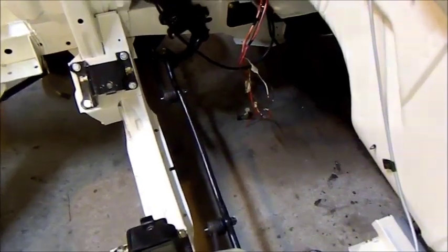And I finally got the right inner tie rod ends, and you can see, looking at this, there's a bit of thread poking through. This is the fourth set I've had. This car is a 1969, a September 69 car, and so it should have had the larger ones, I would have thought, but according to the catalogues, they changed in June.